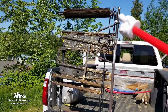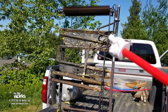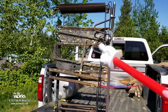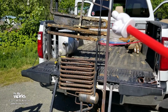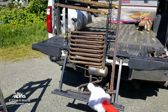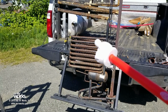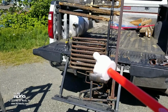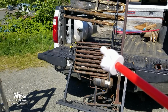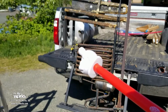The rectifier goes up, a lot of surface area. Sometimes you'll even have dimples on here that are even more surface area that the water can kind of collect on and drop out. The ammonia continues up to the top as a vapor. The water falls out. The water falls down onto the outer tube, goes into this smaller tube, and the water then comes up to the top of the merry-go-round, the roller coaster thing. Now we're going to pick that water back up in a minute, but that's going to be some pretty hot water, okay? We need water entering the top of this, okay?